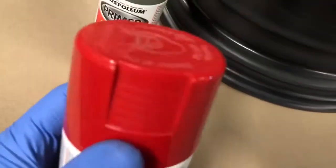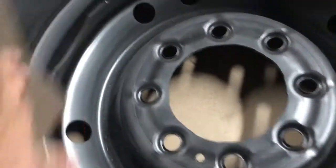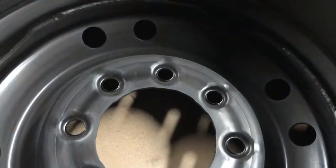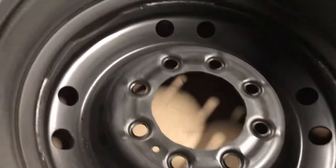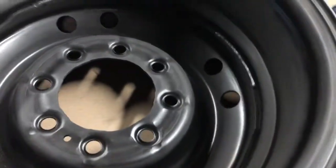This is a red gloss paint. What I'm doing right now — you can see the rim here, and the black on my hands — I'm actually sanding it down with Scotch-Brite, just giving it a quick key. Nothing special, just a little bit all over, so that when I do the priming — because it is already primed — it'll have something to bite into. I'm going to be painting it with a gray primer, which helps because the primary color I want is red. If I paint over black it'll be a darker red, but with a gray base it'll be truer.